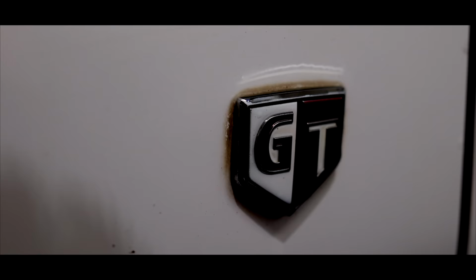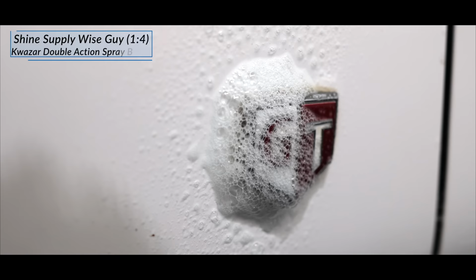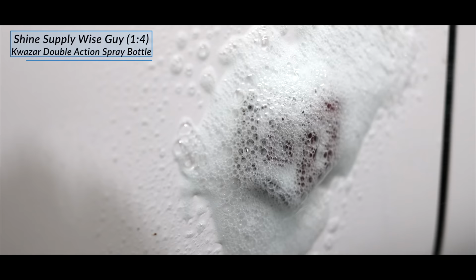Now, around some of the trims and badges, there was some extremely stubborn grime, so I'll walk you through the process I used to remove it. You want to start with an alkaline-based all-purpose cleaner or degreaser dilution, spray it on nice and generously, and give it a minute or two to start softening the grime.